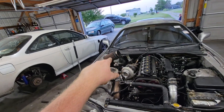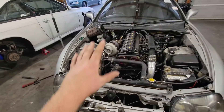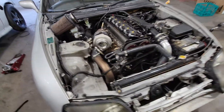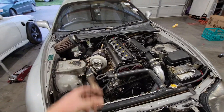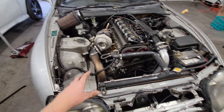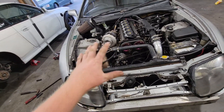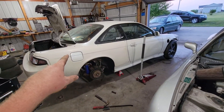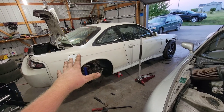Just for example, I was running it with the filter and that takes up a lot of the sound, so that is just freaking wild. I also figured out what the smoke was coming from — I'm pretty stupid for not realizing it. The coupler was touching the manifold. Merle said he's going to weld on an elbow for me, so I'm going to order an elbow for my compressor housing, he'll weld that on, and we'll be good to go and get this thing tuned for boost. But that thing is next — the other car is going on hold. Now that this is finished-ish, that thing is ready. Coming up next for everybody waiting for Rice Box — now's the time. That's going to be it for this video, stay tuned for Rice Box and I'll catch you guys in the next one.